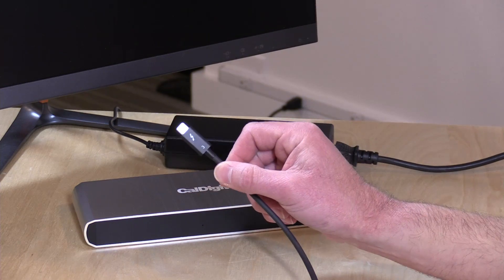You need a tried and true Thunderbolt 3 cable. The big difference between USB-C and Thunderbolt 3 is really speed — these cables can transmit 40 gigabits per second of data versus 10 on USB Type-C. When you're connecting displays, Ethernet, and USB devices, that makes a difference. On some USB Type-C docks, when multiple displays are connected, the USB ports slow down because there's not enough bandwidth for video and other data simultaneously. As you'll see in a moment, this Thunderbolt dock keeps up quite nicely.